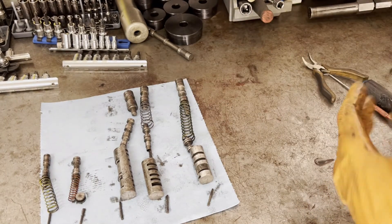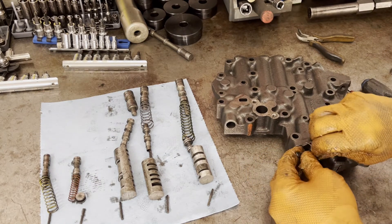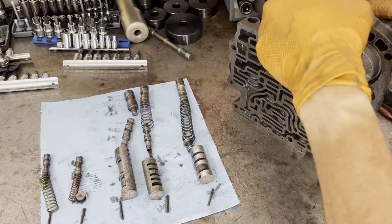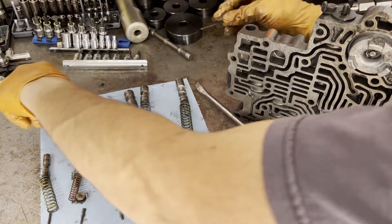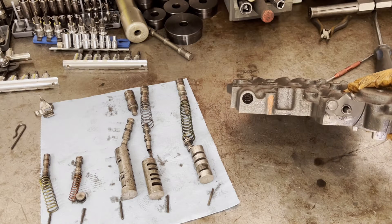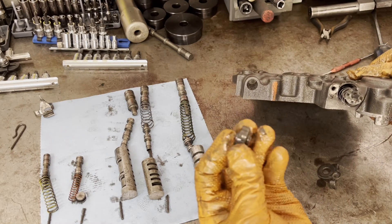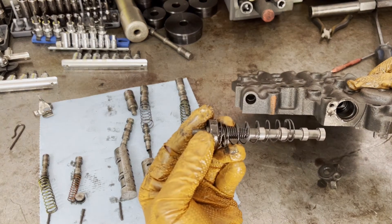This side's empty. Now it's time to come over here and take out the detent valve. Once it's loose, you can just take it out. It's a 7/16 bolt. This is dual-sided — it doesn't matter which orientation it goes. And there's the whole valve train.